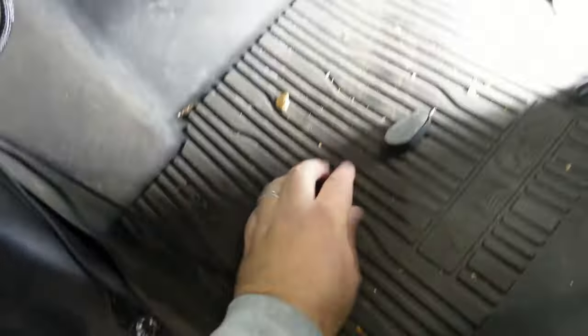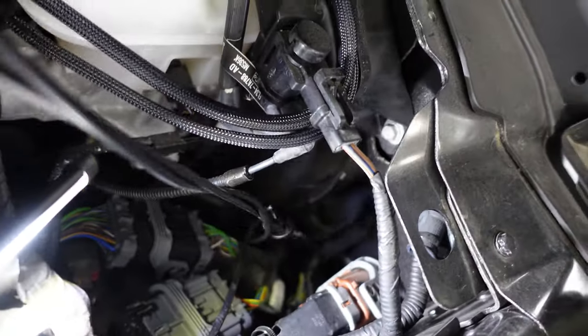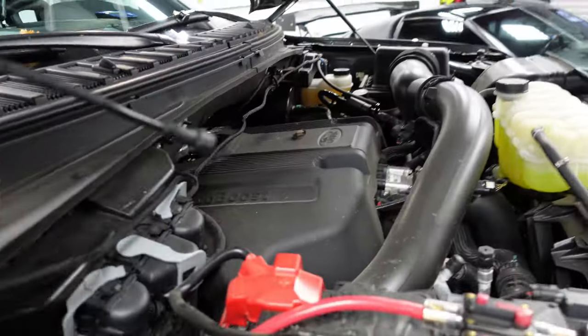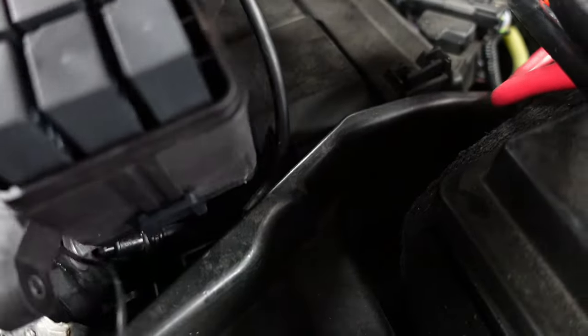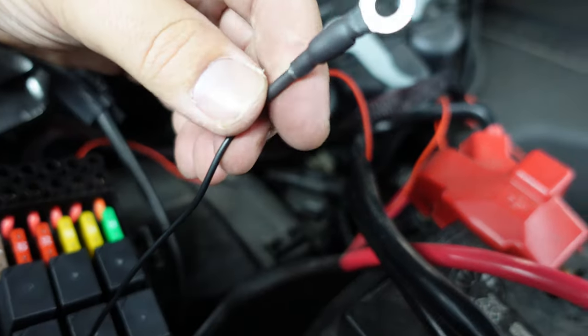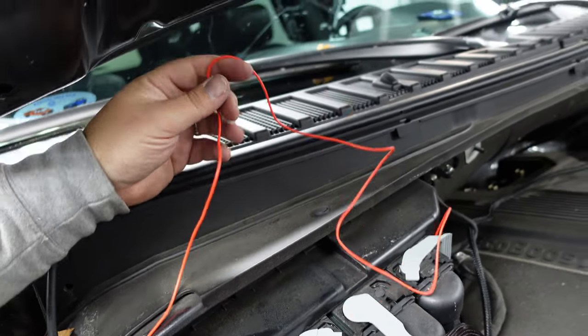I have taped the wire off, cut the old ones off, and now I'm just going to pull it through. Here it comes. Now I'm going to fish this wire to the other side. I've got the switch wiring harness right here. Now to figure out where we can mount the main switch box. So this is where I'm going to mount it — there is a bolt that I'll show you once it's mounted. This ground wire for this box was about 10 feet long, so I just cut it and put a connector on here because I'll ground it right here. I don't need the positive accessory wire because I want to be able to turn the lights on when the car is completely off and no accessory switch is on.